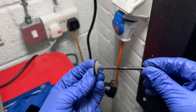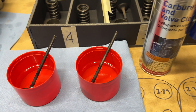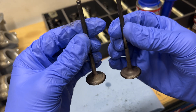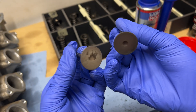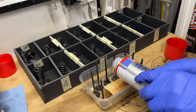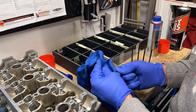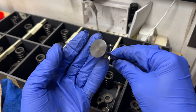After 20 minutes it had taken some off, but the solution was probably too weak to break down the carbon, so I did a little test. The left one is neat brake cleaner, and the right one is a specific valve and carburettor cleaner — the type you normally put directly into the fuel tank. After an hour, I gave them both a scrub with green scotch brite and assessed them. There wasn't a lot in it, but the dedicated cleaning stuff did a slightly better job at breaking down the carbon, so I laid them all out and left them to soak for a few hours. Then I gave them a scrub up with the scotch brite and a wipe down with a rag.